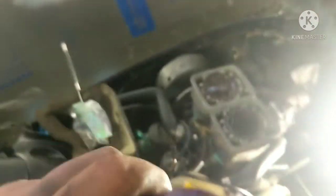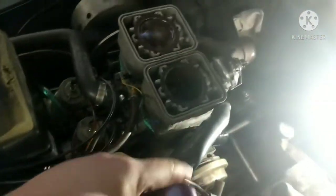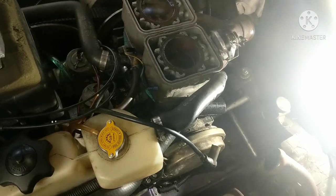The cylinder head here, so got the thermostat and stuff in it. So I'm gonna put this on, put our O-rings on first, and the bolts get torqued to 21 foot-pounds. So as you can see, that's gonna look really nice on there. So let's get to putting the bolts in here, first with the O-rings on, so that way it seals and everything. So let's get to it.